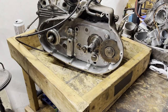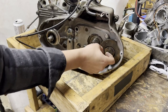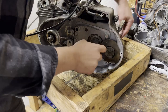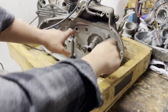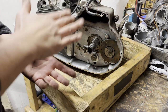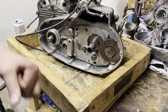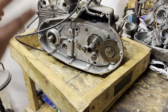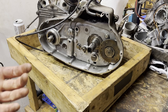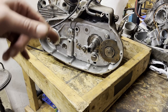Motor's in the box. First thing I'm going to do: the kickstart gear needs to come off, so I've got to pop the lock washer tabs down. Impact on this — we'll rip this off. Then yank the starter shaft, which gives us access to the four bolts for the transmission. Pull the four bolts on the transmission, drop the needle bearings inside the case, organize those, and push them off to the side. That will free up the back side of the motor. Then we'll go around to the other side, do some marking on the cam chest where the timing is set, pull the cams, ignition, and the drive gears for the generator. Trans first, then we'll move on to the cam side.